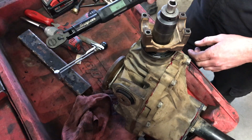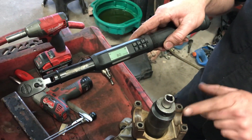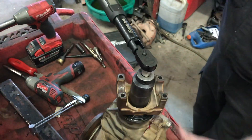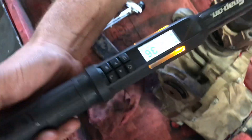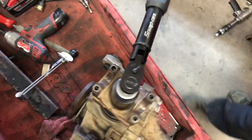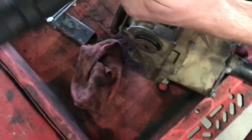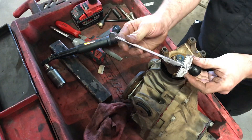But I already have a Snap-on Tech Angle. I set it higher than the spec for this pinion, so it's at 80. This thing will show me what the current torque is. As I spin that around, I'm around 35, 36 — which is almost the same as what the beam wrench was showing.